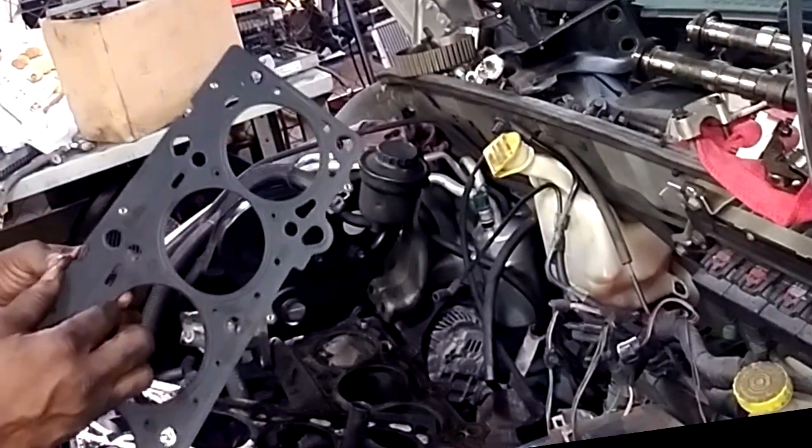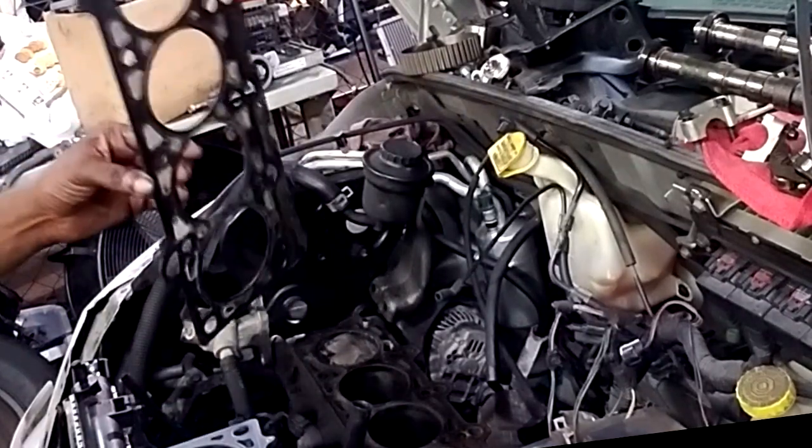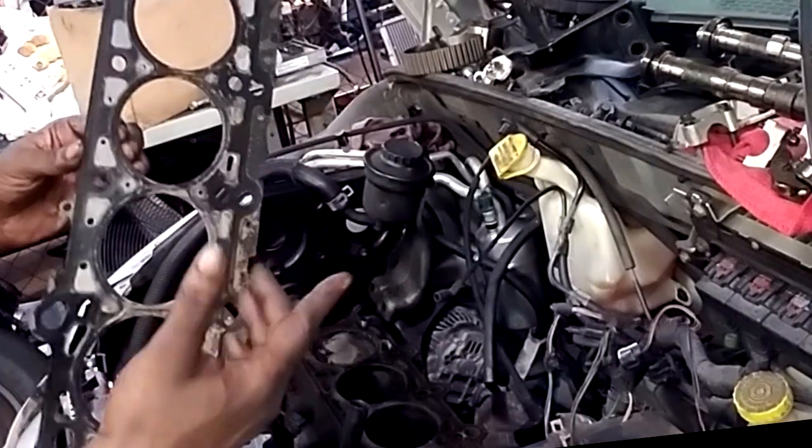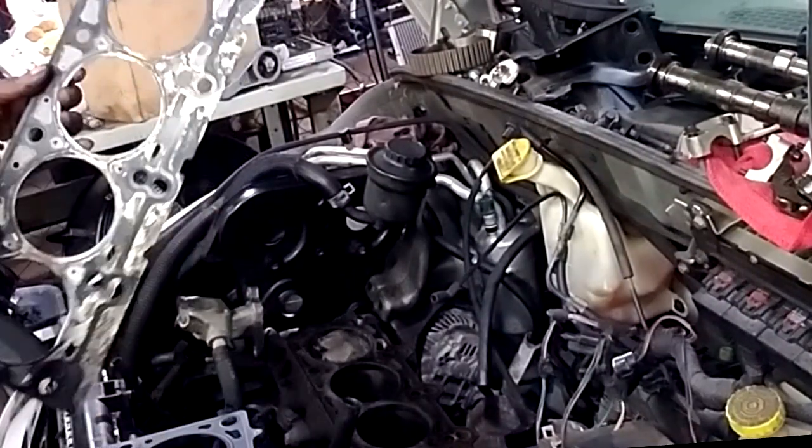That's all I have on this. I pulled the old cylinder head out — the head is back from the machine shop. I'm not sure if I'll be able to shoot a video of me installing it, but for the most part this multi-layer cylinder head gasket is being removed because we sent the head out to the machine shop to get pressure tested and straightened. Thanks for watching, comment and subscribe, and we're gonna get this engine back together with this brand new multi-layer steel head gasket.